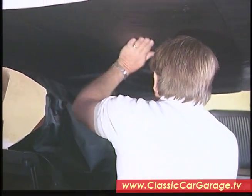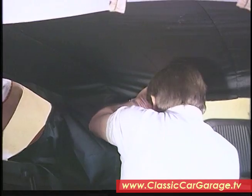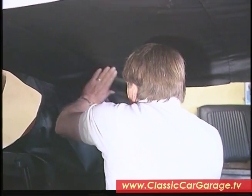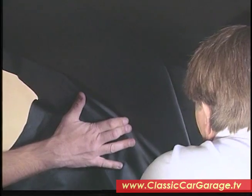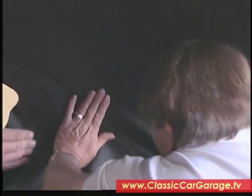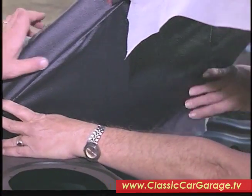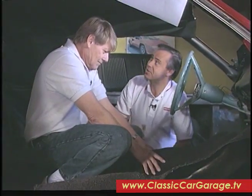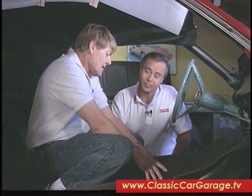What you do is set this bow first, getting it stretched out and tucked up underneath. Then you smooth your headlining out, set that next bow, and tuck that. Then you come back and bring it smoothly back in your corner, and just stretch that quarter out — it comes out real smooth, just like that. The headliner is starting to look pretty good. Also — let the glue set up a little bit, about five or ten minutes, before you start gluing. Otherwise the adhesive doesn't really stick well.